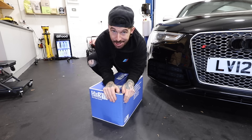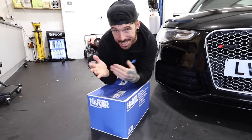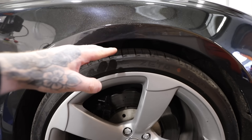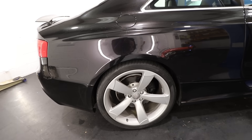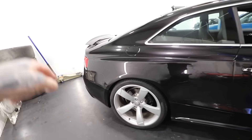We've got loads of modifications to get through. One of the first things I want to do — which I do to all my cars and I'm sure Hannah will approve — is lower it. I've just got some H&R lowering springs, which use the standard dampers. It should lower the car by around 30 to 35 mil, which should improve the look and the handling. Right now the front ride height isn't too bad, but it would look a lot cleaner if it just sat a tiny bit lower. These lowering springs should definitely improve the look of it.